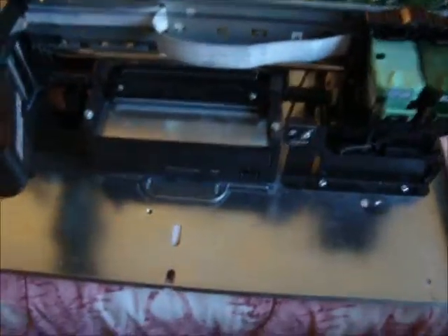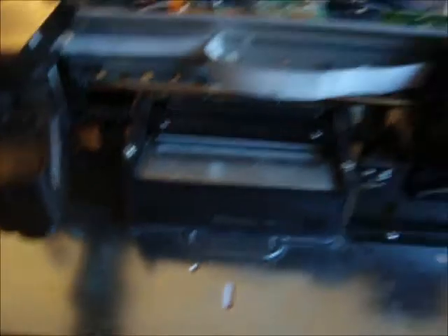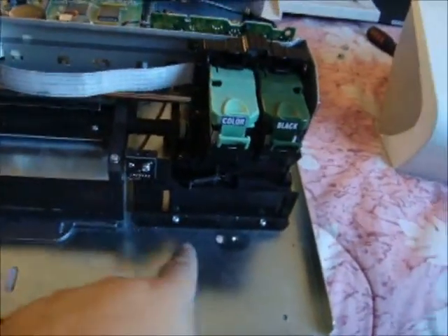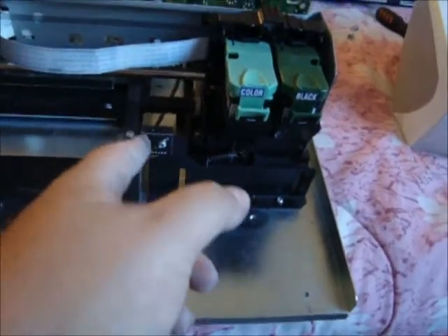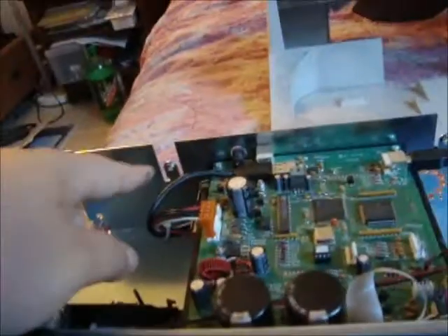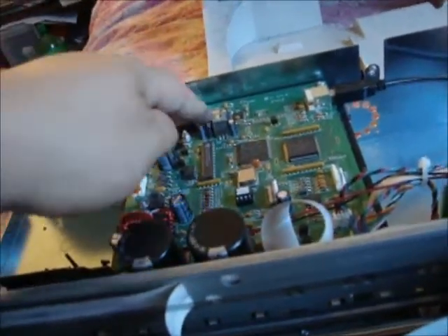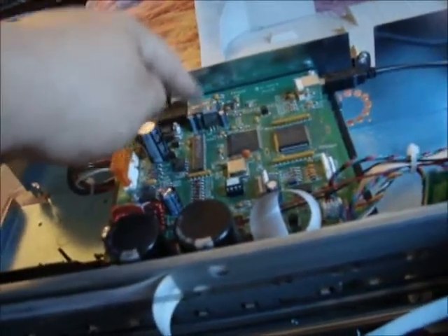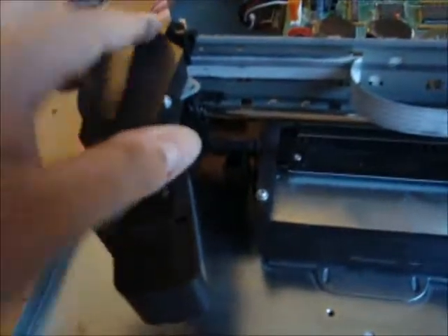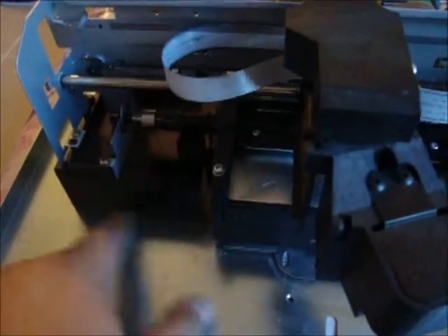Everything is finished — you're all done. So that is the changing of your DVD drive. If you run into any problems, make sure that when you removed those two screws, you didn't somehow knock or jar this light sensor. If you damage this light sensor, you can't print. Don't forget your connections — on my unit, they originally had hot glue on here, and as time went by it dried off and fell off. If you're having connection issues, maybe just dab some hot glue again. This is for your printer and this is for your DVD drive. And if you notice that your robotic arm is not properly centered or things just don't seem right, double check that you didn't lose your alignment.